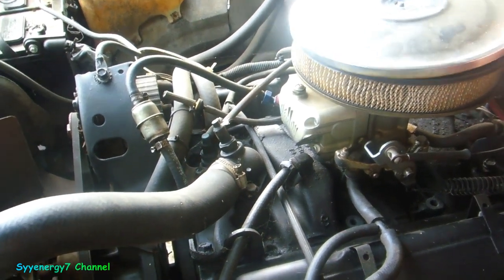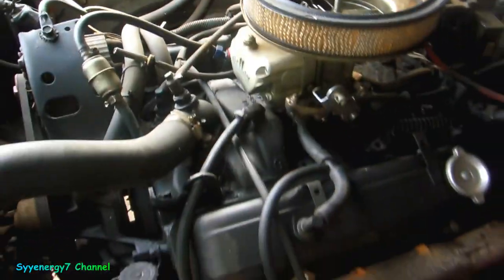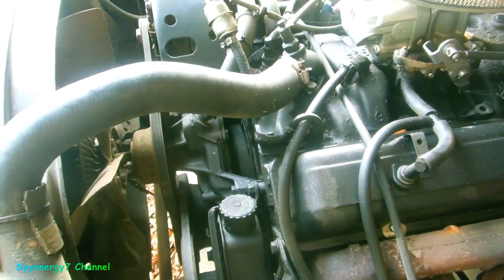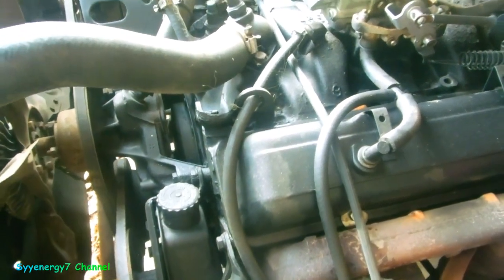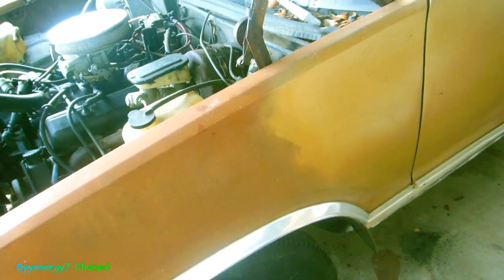You know what doesn't clean it? Gum out. What I found out is how you actually clean it — you take starting fluid and just douse it down in there. Not what I'm doing now, this is just to start it up. But after you douse it, you stop the engine, douse a bunch of starting fluid in it, let it sit a few hours, and the starting fluid will actually melt the varnish in the carburetor better than any carb cleaner. You just gotta let it sit a while before you try to get it started.